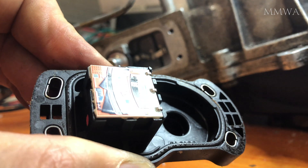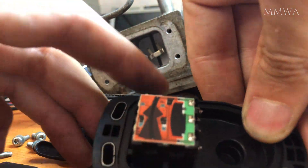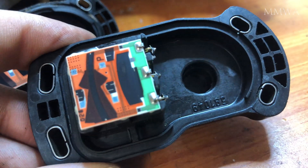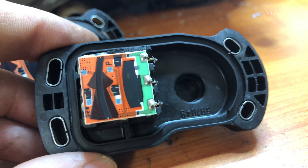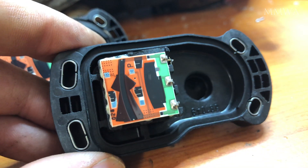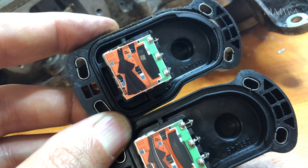The new one is a solid black track — you don't have these kinds of holes. For comparison, this is the unit that came off my blue-black W124 when I first got it. I changed it over, and this is 180,000 kilometers worth of wear. The other one is obviously original to the red car — it's currently at 307,000 kilometers, but I don't know when it was changed over. Presumably the previous owner changed it when troubleshooting running and starting issues, though I'm not sure that would have really saved it, because it was also a piece of crap.